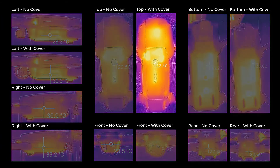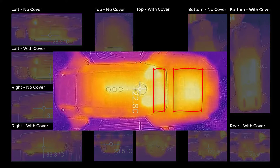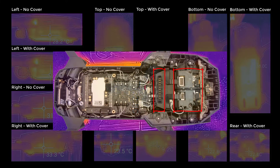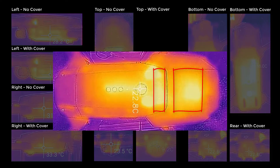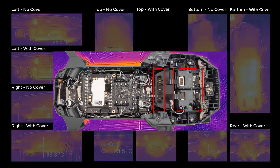There are two areas on here that I really want to take a look at that have shown up quite noticeably. If we zoom in around the middle and the front of the Mavic and tear away to have a look inside, what we can see is that the two areas showing up on the heat blooms are the forward avoidance system and, not very surprisingly, the battery connector — which is obviously generating quite a bit of heat through the current being drawn from the battery compartment itself. Zooming back out again, you can see those heat blooms quite clearly, and putting them back you can see those components relate directly to those items.